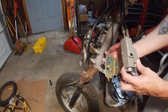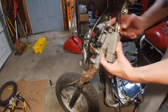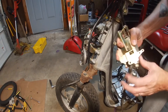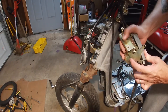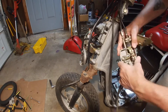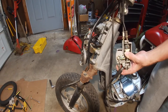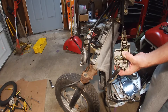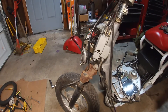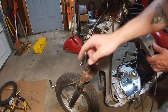This is bolted onto there — there's a bolt attached to the bracket, a bolt through here that's kind of hard to get, and another bolt here. I don't think I need to take that last one off, just the two. I can then remove this weird contraption — it's like a brake balancer or something. The rear brake just kind of pulls on the rear brake. I'm going to take that off, remove these from the handlebar, and put ruckus-length cables in for the front and for the rear.